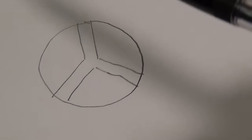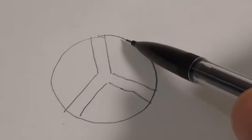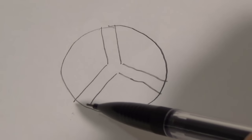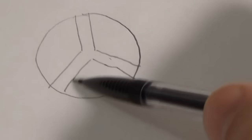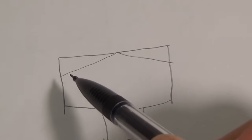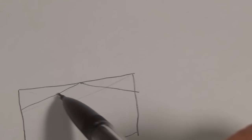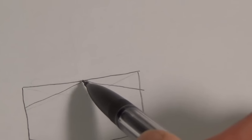Here's my little sketch of what the top of this screw looks like. There are tri-bit screws and screwdrivers out there — a lot of Nintendo games have these — but I went online and discovered I couldn't find one that fits this particular pattern. If you cut a cross-section through here, these little grooves actually start high and go down. Many other tri-bit ones go down like a typical Phillips screw, but these are highest in the center and lowest on the edge, and I just can't find this anywhere online.